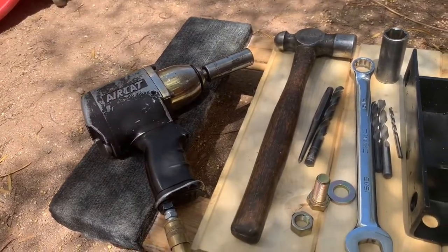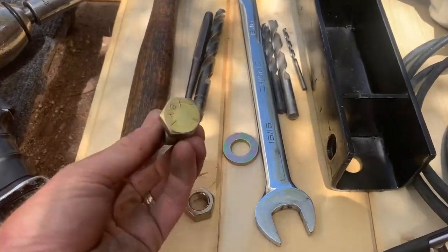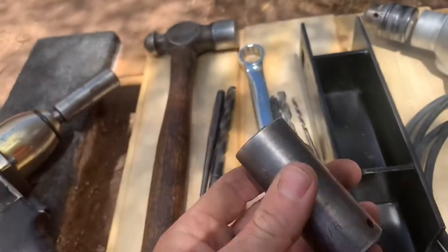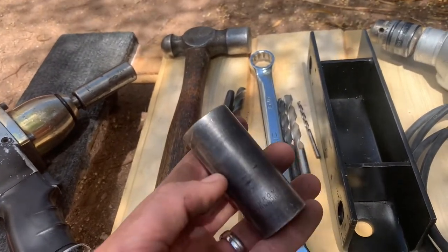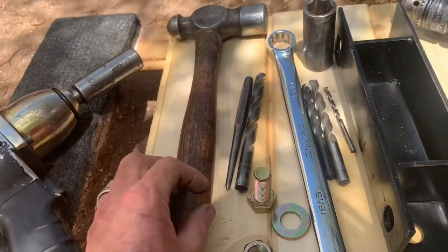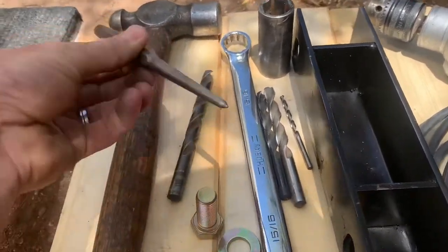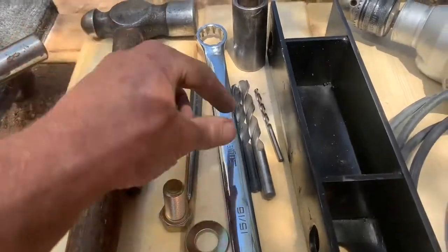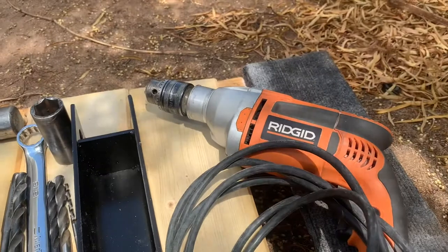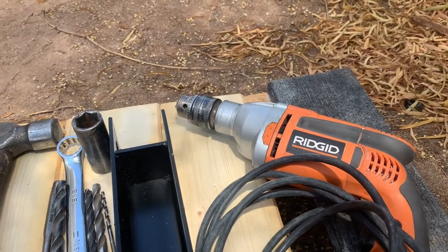Here are some of the tools that you will need. The anodized bolts that the lift kit came with require 15 sixteenths — there's a 15 sixteenths wrench, box end. If you have pneumatic tools, it's going to be way easier. Also a 15/16 socket for the nut. And it looks like we're going to have to drill a hole in the side of the frame of the Airstream, so I have a center punch, a hammer, and a bunch of drill bits to step up to the right size. A cordless drill may suffice, but a corded drill is really nice.